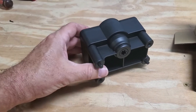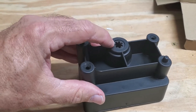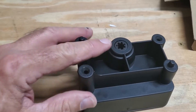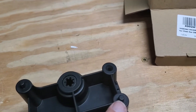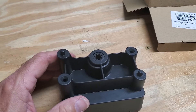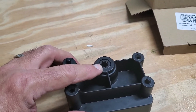This is what the M-Core module looks like. It has a spline section here for the spline shaft that's attached to the accelerator pedal — fits right into there. It has two screw mounting holes, two alignment pins so you can't put it in wrong. You just have to make sure the pedal is not depressed so that the splines line up in timing with the pedal.